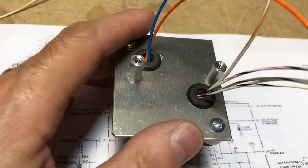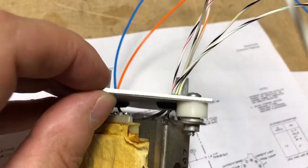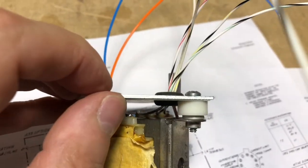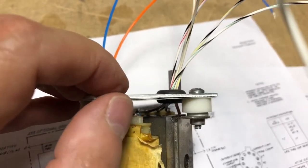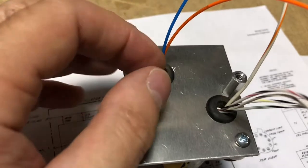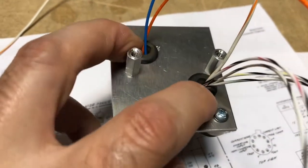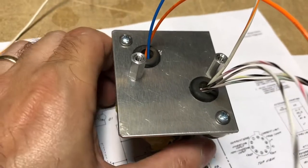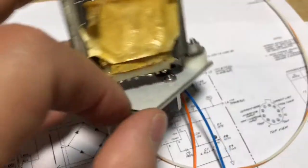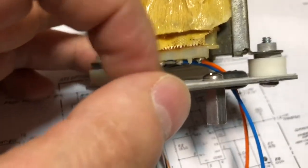As far as the construction goes, it took a little bit of playing around to get the shape and everything laid out — there's not a whole lot of room, this fits pretty snugly in the available space. A thick piece of aluminum plate, I think it's 0.04 or 0.063 inch gauge aluminum, cut and mounted with some standoffs for attaching to the chassis of the 5340, with rubber grommets to feed through the transformer leads. On top I've laid a piece of fish paper down just to provide some extra insulation between the transformer connections and the base.